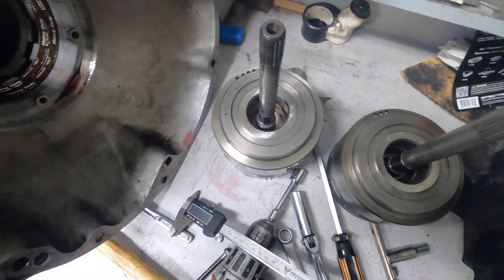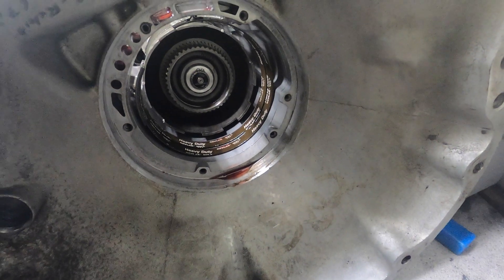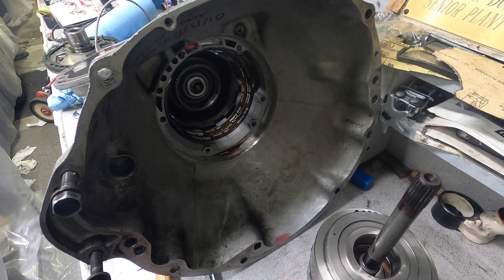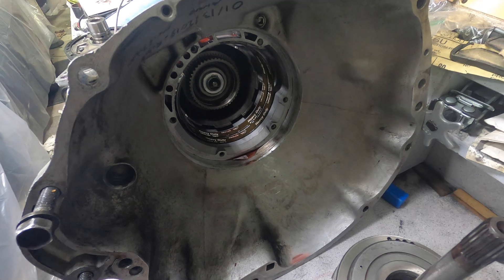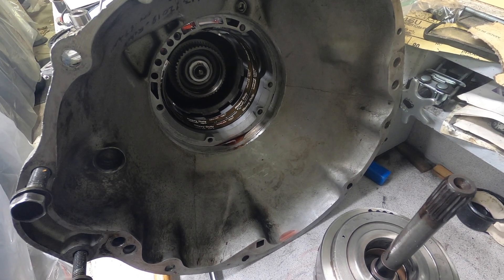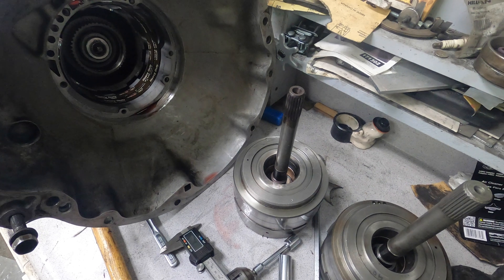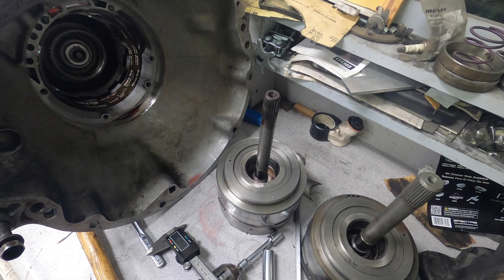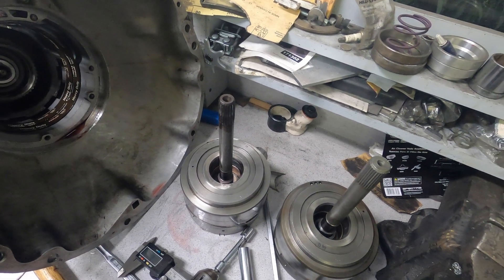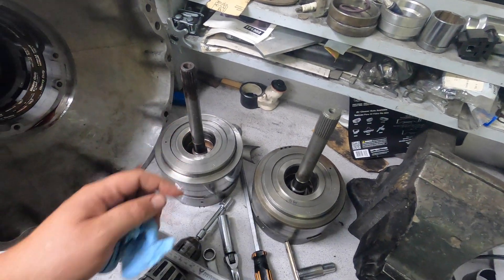I found this out by chance because I had rebuilt this transmission. To save time and reduce downtime, I bought a transmission off Craigslist and hadn't realized the input shafts were different. I rebuilt it, put everything together, and then the torque converter wouldn't fit. The guy from Craigslist gave me his torque converter, but then it wouldn't actually fit into the block — there's a machined hole where the little nub goes into the crank, and it's a little bit smaller on the 273 than on the 318. As a result, I had to use the original 67 spline on this transmission.